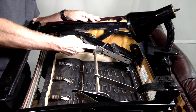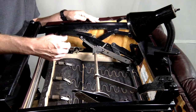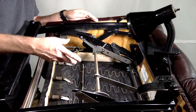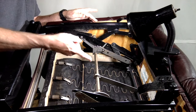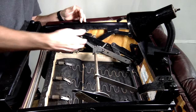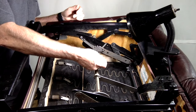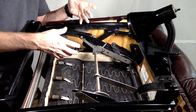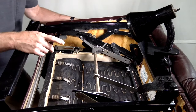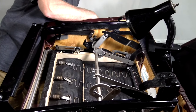Let's say your setup is not operating as smoothly and you want to disconnect it for now. That's a good strategy because later you can always decide — if parts are available — you're going to rebuild, leave it off, or perhaps convert it. The first thing you want to do before you disconnect is make sure the chair is completely closed or all the way open. If it's stuck in between, do not remove or disconnect this, because when you pull the bullet pin out that's holding the chair in place, the scissors will either fly open or slam shut. If it's stuck in the middle, use the handle to try to work it back and forth to get it to open or close all the way.